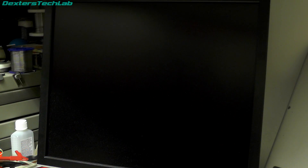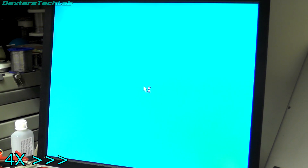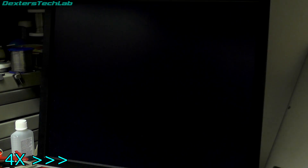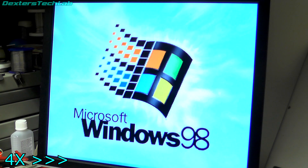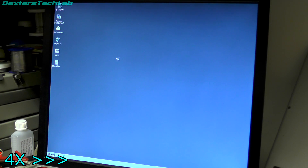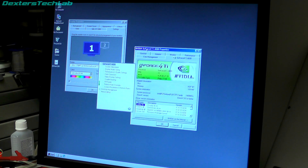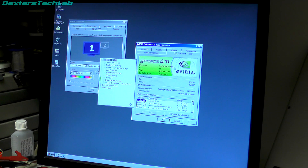Off camera I've just verified the VGA port works fine so we're just going to boot into Windows and see what we get. I've just got the display properties there and yeah, GeForce 4 TI 4600, 4 times AGP which is the best this motherboard does, 128 meg RAM - that's all fine. So yeah we're looking really really good on this.